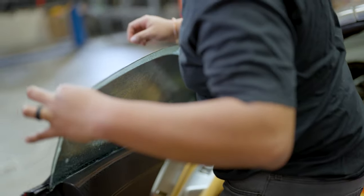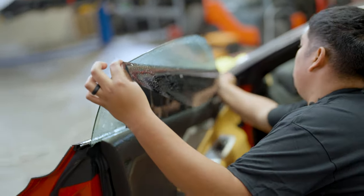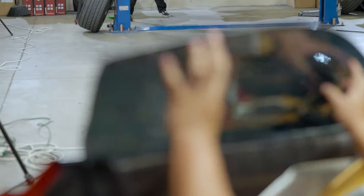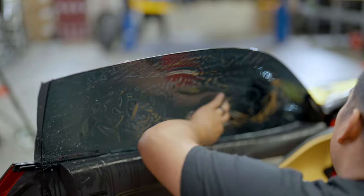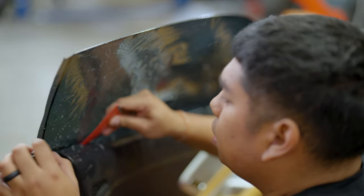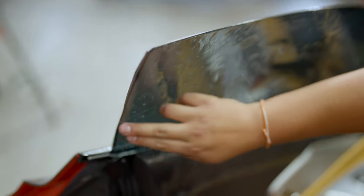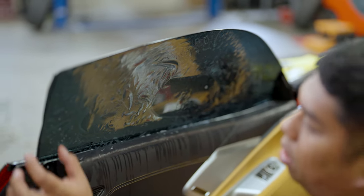Go back to the other side, tuck your nail behind, pick it up towards the middle, fold your top edge down, pull it over, flip it back up, lay your inside corner, then lay the rest of your film. Your main goal is to line up your factory edge up top as close as possible. Since this is a frameless window we'll be shaving at the end anyway. Spray your film. To tuck behind the gaskets, use a hard card. We left that half-inch gap on the outside — now we're down to about 3/16 to a quarter inch because we had to tuck past the seal in the corner, making up for that half inch given up on the edge.